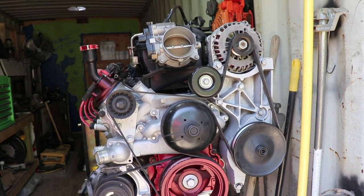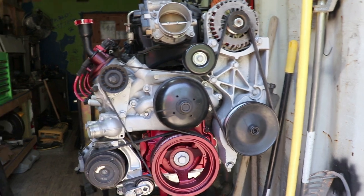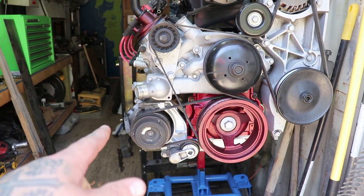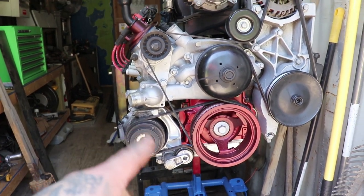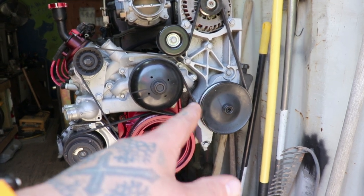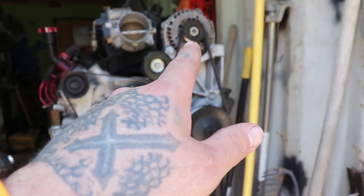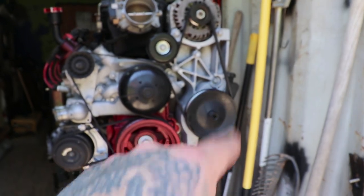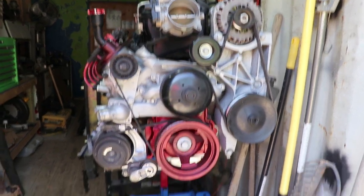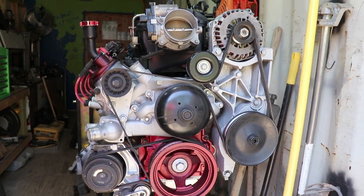It's got a DoD delete with the valley tray. It's also got a new timing chain, new timing gear, new harmonic balancer, and some other accessories. It has a new AC compressor, but we're not going to run that — I don't have AC in that truck. It has a new power steering pump, but I don't have power steering so that's going to come off. That'll leave us with the alternator — we'll have to figure out where to put the alternator and get a shorter belt. That should give us a little more room in the engine bay. That's where we're standing — thank you for watching.